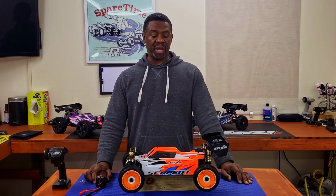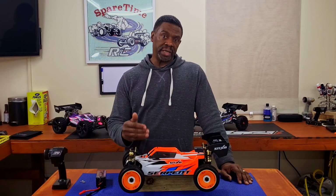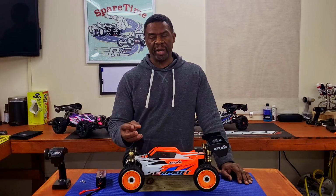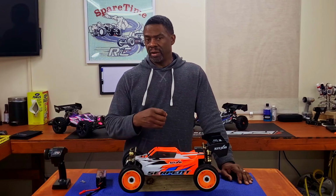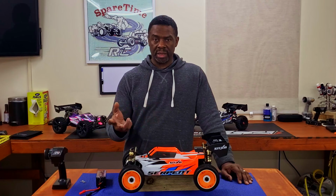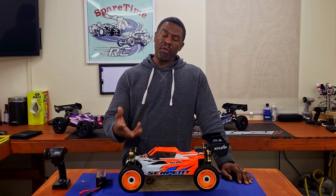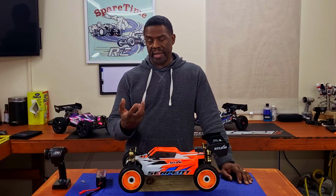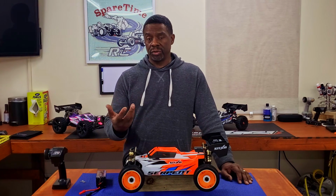And I tell you straight out the box, it is straight out the box. Do I add oil to it? Yes, still straight out the box. I want to make sure that my gears are not metal on metal, so I don't have any issue of cracking the gear or chipping a tooth off one of the gears or overheating the gearbox diff itself to the point where it's starting to melt or I can't get it apart or it's just leaking oil.